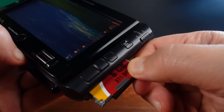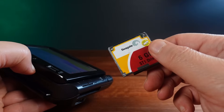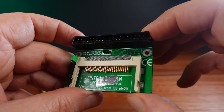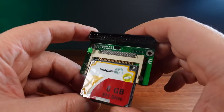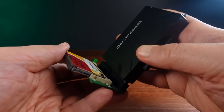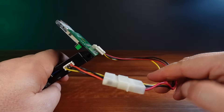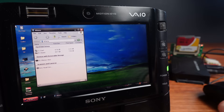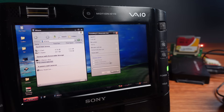Testing the drive in my VAIO, and as expected from the 'Embedded' label on this drive, it doesn't get detected using the built-in compact flash slot. So I've got something else here to use — it's a compact flash slot to standard parallel IDE hard drive adapter board. I also have a USB to IDE hard drive interface. I just need to connect these two adapters together, include a drive power cable, and now I can power this up and see what happens. The embedded MicroDrive is being detected and it looks like it's all working fine, which means the Creative Zen Micro probably also works fine and just needs a battery.